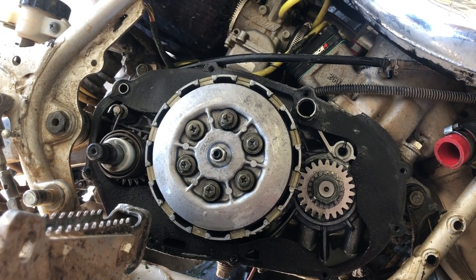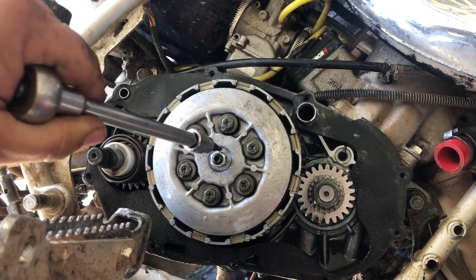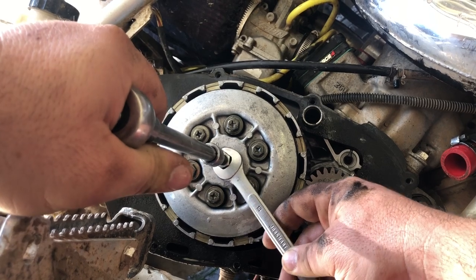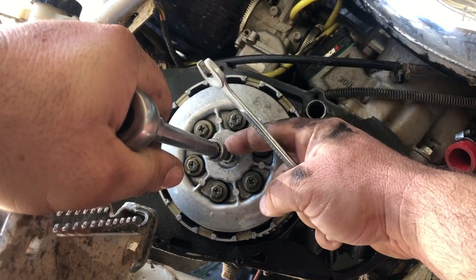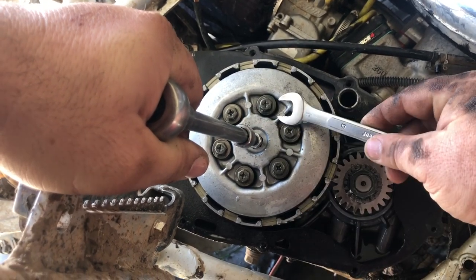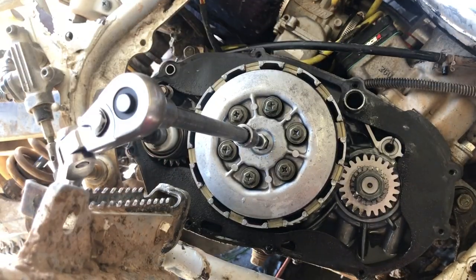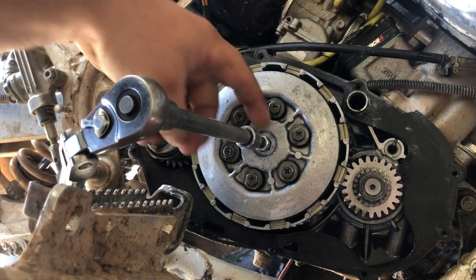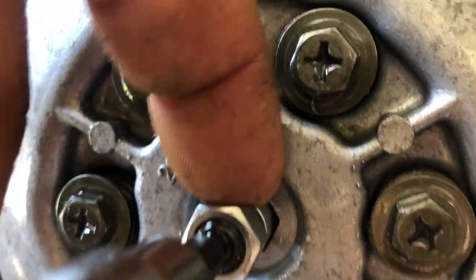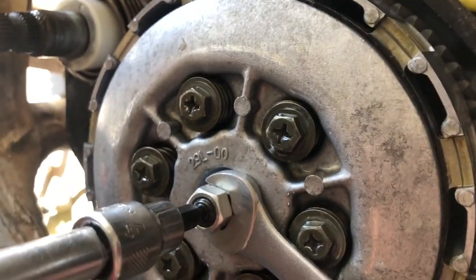Not the lock nut — the whole thing will spin together as one; it's supposed to be that loose, not tight. So go ahead and break the lock nut loose. You want to break it loose on the Yamaha one too — that's also going to be this loose, it has a Phillips head. To loosen the pancake bearing it's a 13mm for the aftermarket one. Get a wrench on those little notches on the actual bearing to keep it from spinning while you work the jam nut.